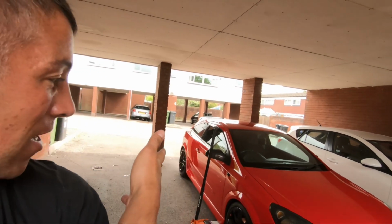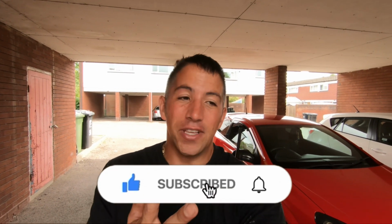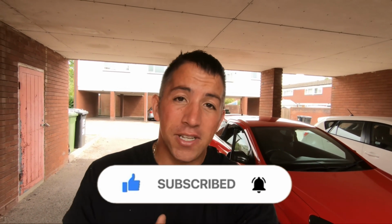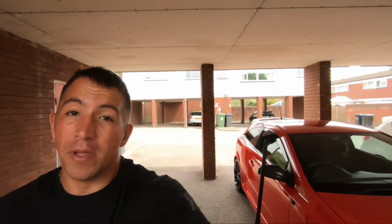Now, as you can see, I'm getting ready to do the wheel bearing on the front of my Astra, as you can see from the title as well. Basically, luckily on these, the front wheel bearings aren't pressed in, they're bolted in. It's like a complete hub assembly. So it's not just a bearing you buy, you get the whole hub assembly as well, which makes it easier to change if you want to do it at home.